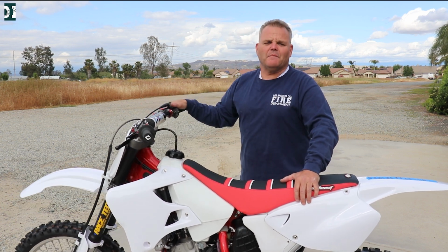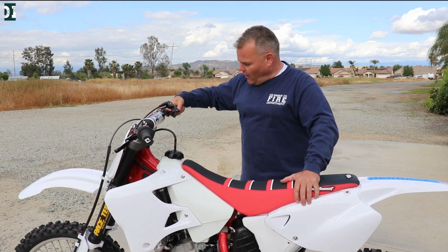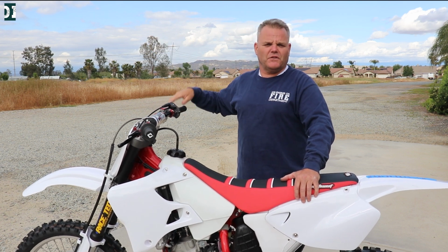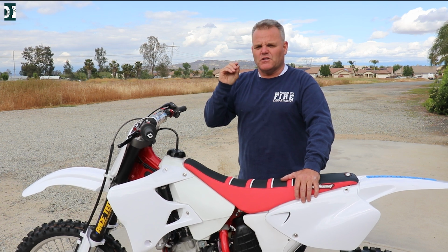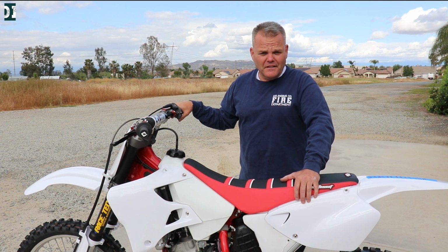Then I'm gonna go back out, now I'm gonna start running through all the gears, and I'm not gonna hold it wide open for a long period of time. I'll hit wide open, but just for a second. As I'm going down in third and fourth gear, I'll just hit wide open, but only for a split second, just making sure nothing feels crazy wrong. Other than that, you're ready to go.